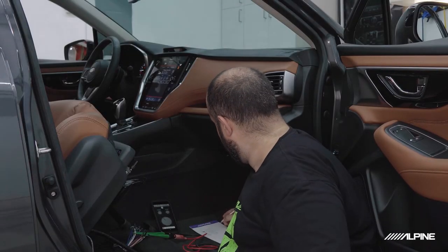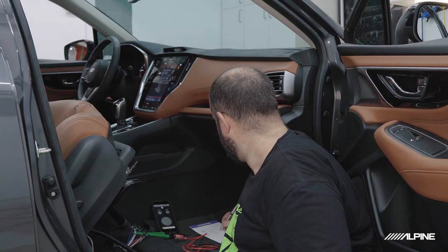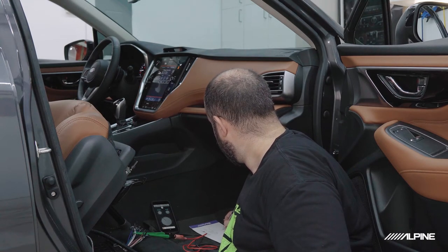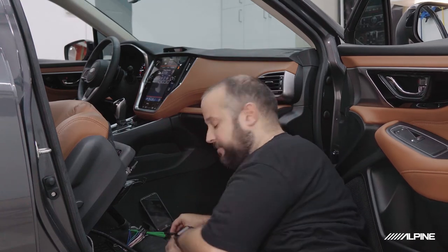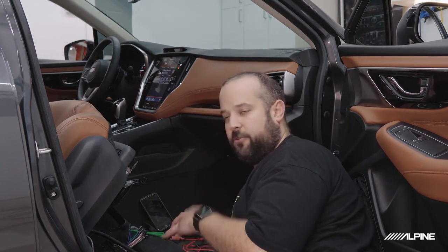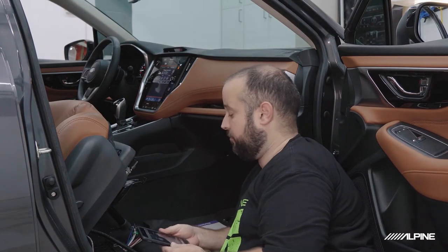And I'm also going to write that the max volume on the sub was 22. And I'm also going to put no clipping. And let's go to one of the door woofers and see what that's doing. Okay, so we're hooked up to one of the door woofers.